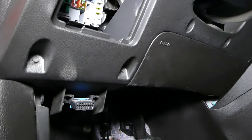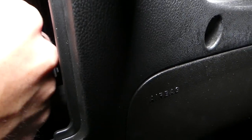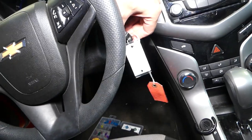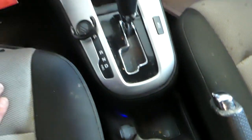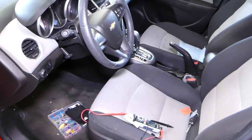I'm going to grab a new fuse and install it in the same place where we removed it. Now I'll turn the ignition on — let me find the key — perfect. Let's see if that works. And as you can see, it works perfectly fine! That's how you take care of the fuse for the front cigarette lighter. Thank you for watching — please subscribe to the channel for more videos and see you next time.